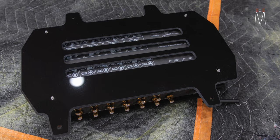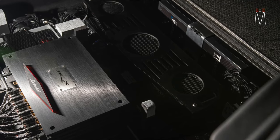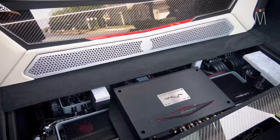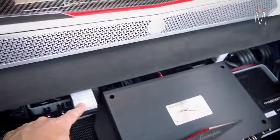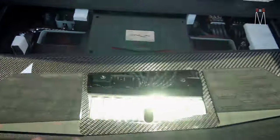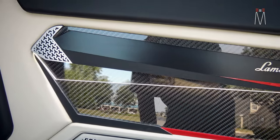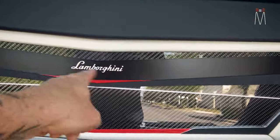I can overlay a picture of the DSP rack so you can see how air circulates through there. We have fans back here too, and I made a rack of fans that goes over the 430 because it's a Class A amp — it's going to get hot. There's plenty of air circulation; you can run this thing all day and it's not even hot to the touch. There are magnets embedded underneath all these white Velcro-style strips and into the underside of this panel, so everything just slides in and goes back together. We also have LED COB lighting that illuminates the edge, visible through the 3/8-inch acrylic to the carbon.